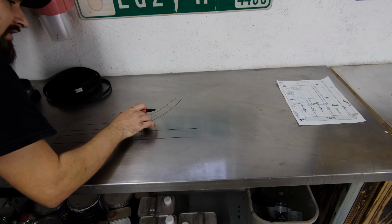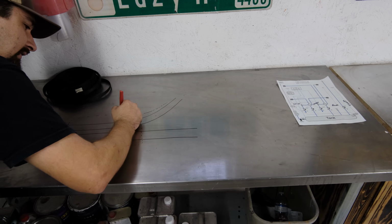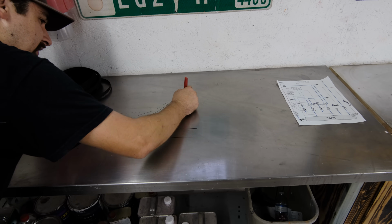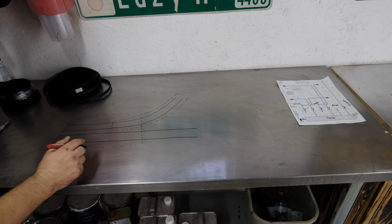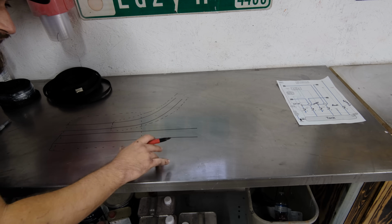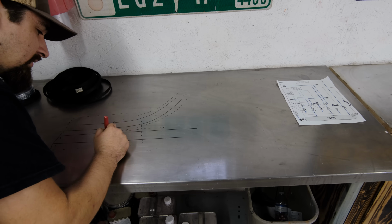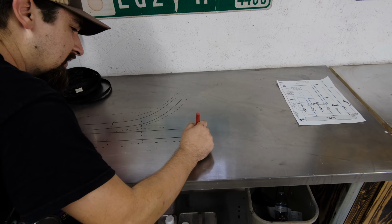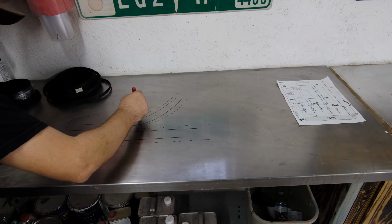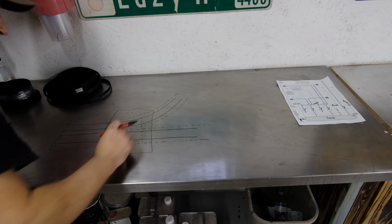But on my two wires that continue off, I want to keep them together, so they're going to get a smaller loom of their own, but that smaller loom is going to tuck back into the bigger loom, and this can continue on infinitely. Then the continuation loom, now keep in mind it could be just these two wires, 3, 4, 5, 6, whatever you want to do, that loom is also going to come into the main loom. So this can continue on, and then we have the main loom, and then we bring in a piece of heat shrink right here that's going to eventually squeeze everything together.